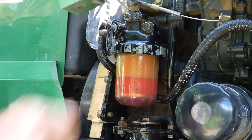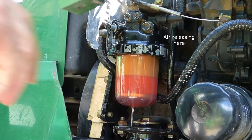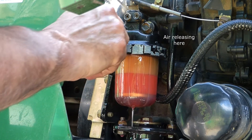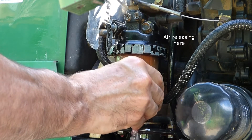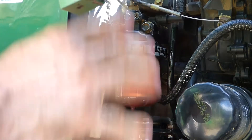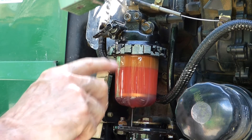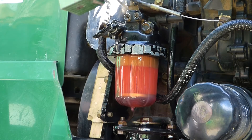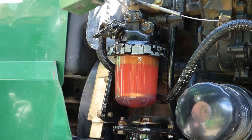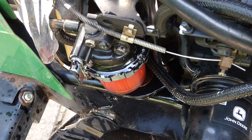Turn the fuel on — it might be a little tight. Let all the air push out and the bowl fill. The trick here is you want to get all the air out. You don't want to just close the fuel line and screw it tight with air in there. If you get air in there, then you've got to bleed it. The other thing you could do is fill the bowl, but this one is so tight in here it would have been hard to do, so I'll just do it this way. The bowl is almost full here — wait until those air bubbles stop.